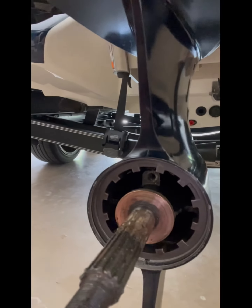All right, it looks pretty clean now. I'm going to look in there and make sure I don't have any grass around my ring. There is an O-ring inside here that you don't want to get destroyed. For the most part, it looks pretty good. Now what I'm going to do is reverse order and put my prop right back on.